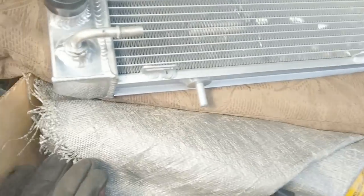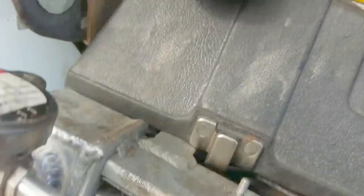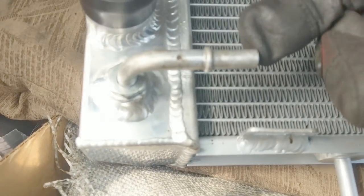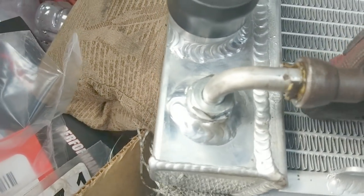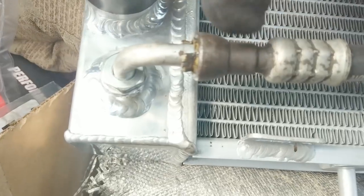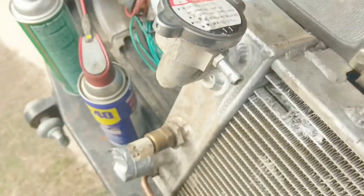So here we are with the Mishimoto. The things we've figured out: this port up here is welded in, which is really obnoxious. I wish they didn't do that so I could unscrew it, because my old one is smaller — small female instead of male. So we're going to try to make a custom adapter for that, or we'll just buy a hose barb. Second, this lower port sticks out just a little bit more than my old copper one. When we push the quick-connect fitting on all the way — that's fully seated — it comes right back off. It can't seat far enough to actually hold. So we've got two options: use a hose cutter to nibble that off and make sure it doesn't eat the O-rings, or just swap the old one on.